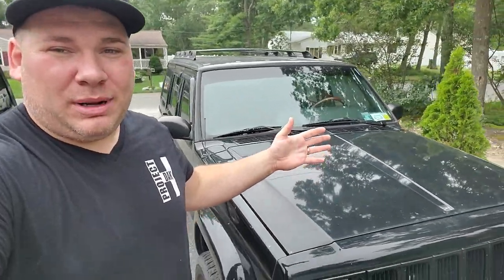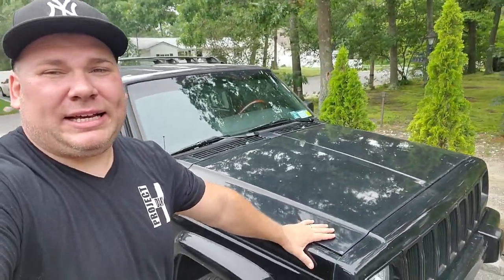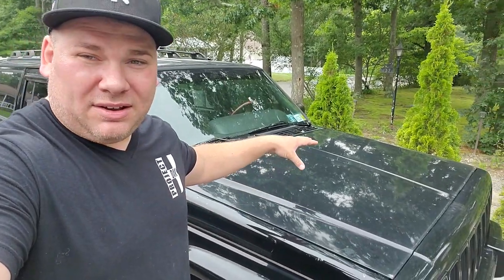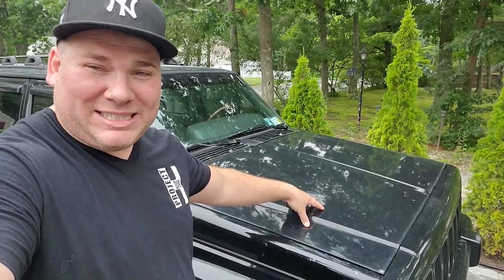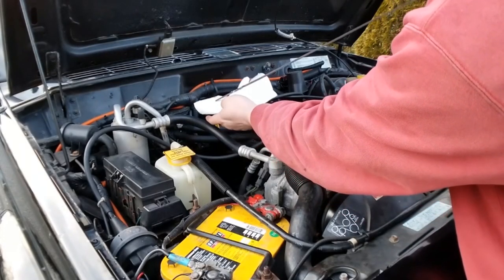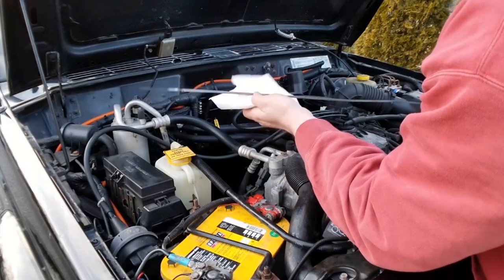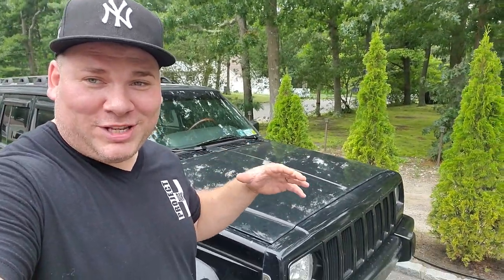I don't know how, but I made a road trip video, and I showed you guys me checking the transmission fluid with the vehicle off. Big mistake. All right, nice and warm, gotta check the trans fluid. So when you wipe it down, you wanna make sure it's nice and pink like that. Everybody knows you check your transmission fluid with the vehicle on in neutral, and I know that, and I don't know why I didn't do it. I think I just had a brain fart.